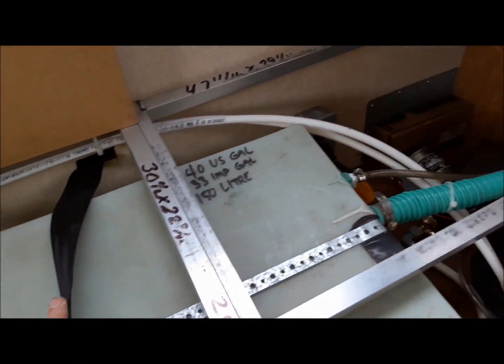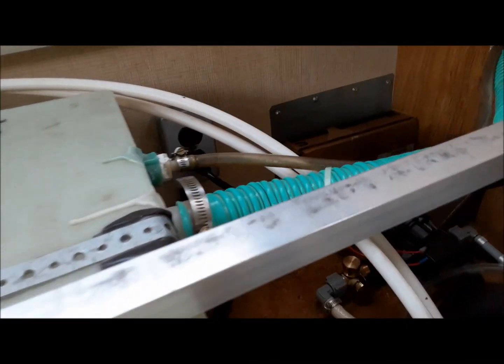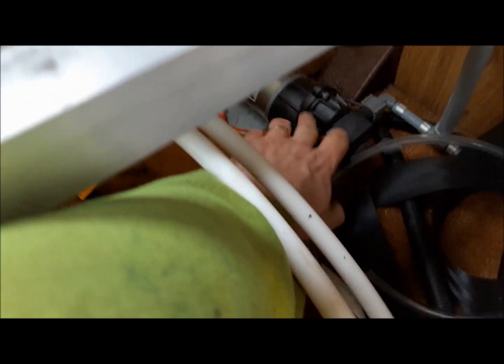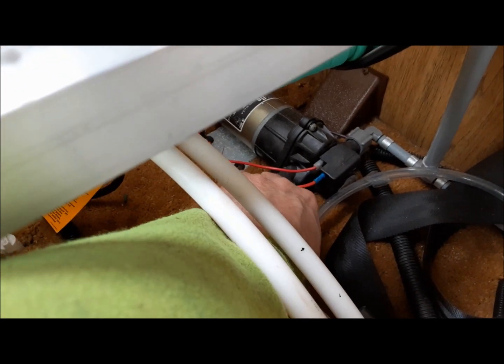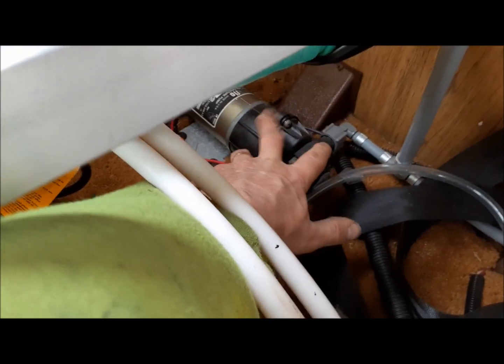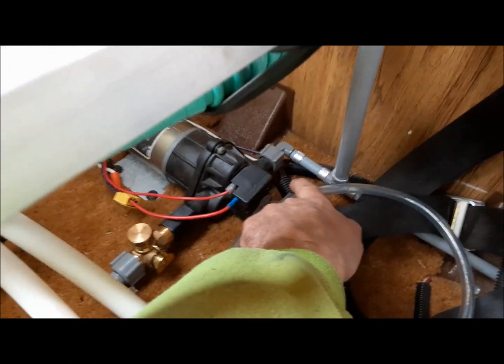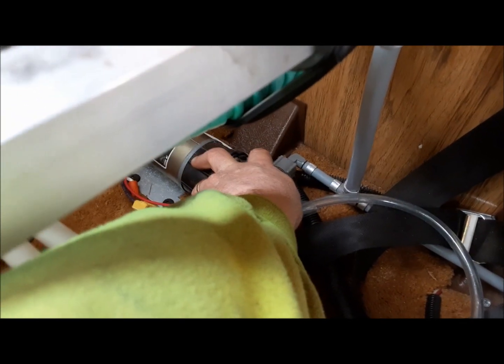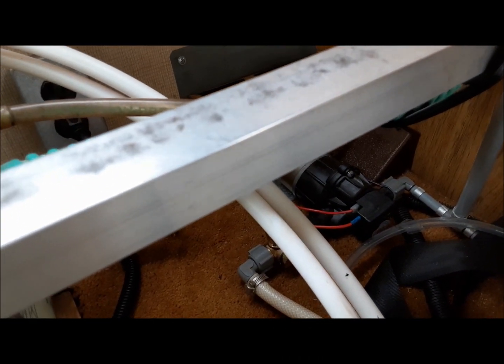The first thing I do after that is we'll put some water in the fresh water tank. That way I run the pump a little bit and get this part, the inlet of the pump and the pump, cleaned out of pink stuff. Because if you go and pressurize it with domestic supply, first you've still got pink stuff in here. See, here's the domestic supply coming in here, and there's a one-way check valve there. So it won't get this pink stuff out of here, and you'll get it all purged out, turn the pump on, and contaminate it all again. So first thing we're going to do is put some water in the fresh tank and run the pump a bit.